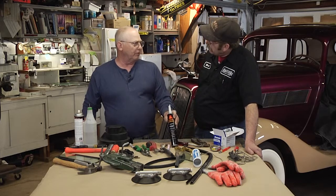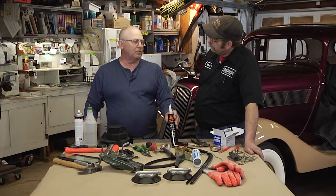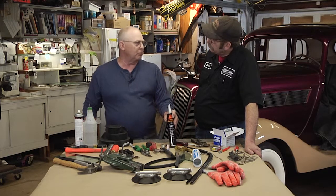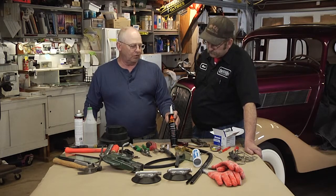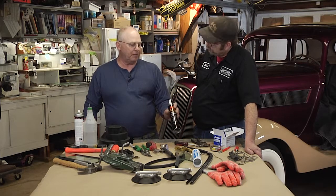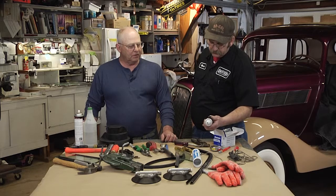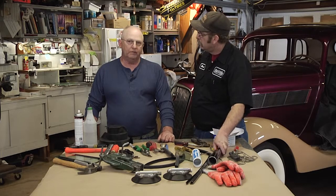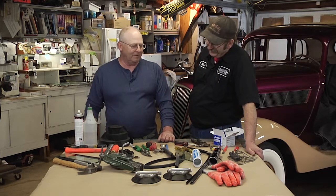We also use it in the street rod world, in the classics world. Like in your 50s cars, some of your 57s, most of your 60s cars, it was actually a sort of butyl set back then. And they have to be replaced with urethane. So yes, you can install it in some of your muscle cars. A lot of your muscle cars are that way. You just put it back in with urethane and you never have to worry about it popping out on you. To do this, you should have not the normal caulking gun, but an electric gun, because that stuff comes out really heavy and hard. You end up with Popeye arms by the time you get done.